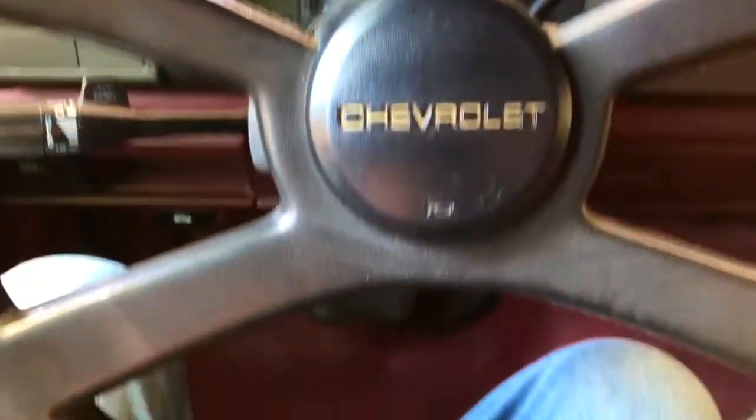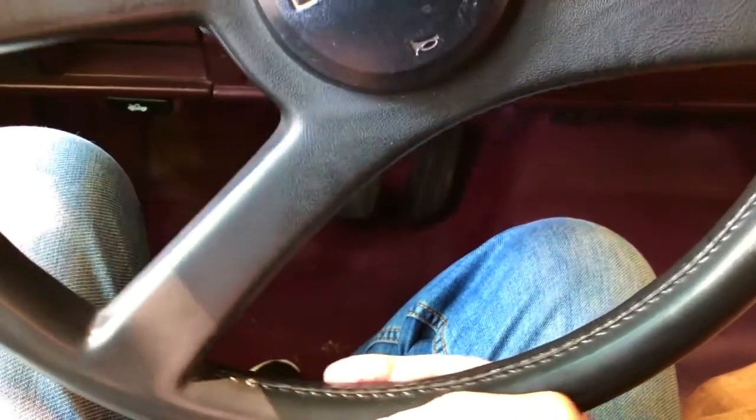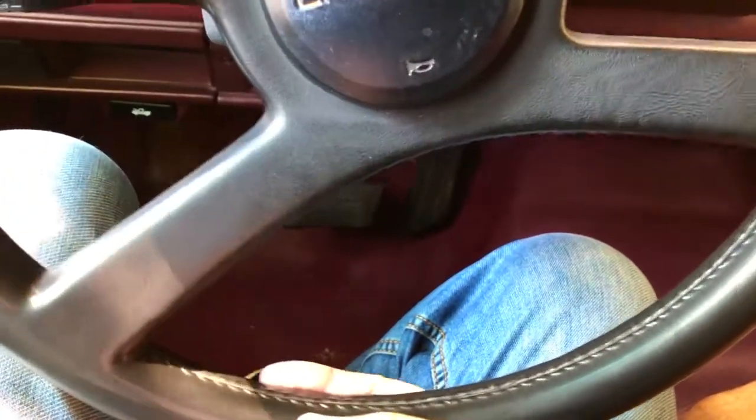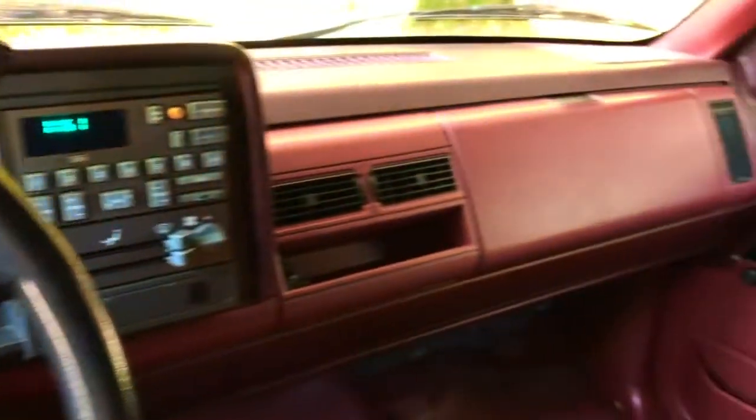Simply take the bottom of your steering wheel and you want the bottom to go to the right. If you turn to the right, see how the bottom is going to the right — that means your trailer will go to the right.